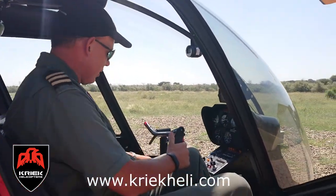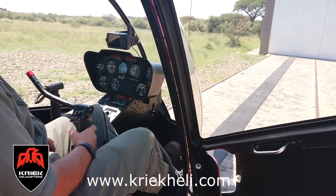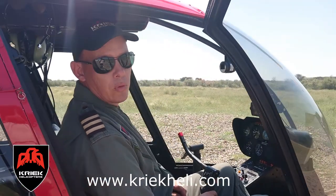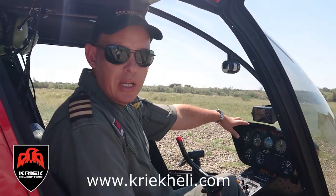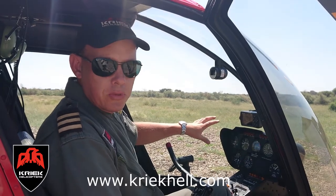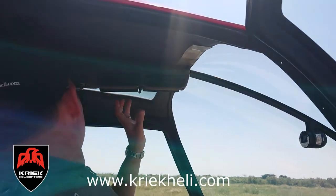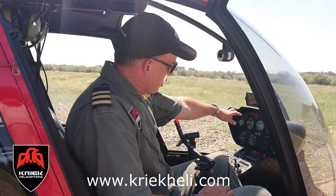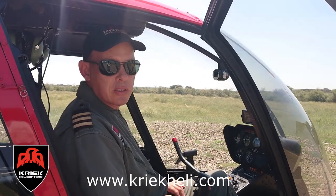This is your pilot seat. Your cyclic lever controls your direction, and there are your anti-torque pedals left and right — basically to counter the torque reaction of the main rotor. That changes the pitch on your tail rotor for torque either to the left or right. You've got your avionics switches — this is the older Robinson cockpit, but you can now get a new one moving more towards the glass cockpit. You can see this machine also has air conditioning up here — it's got a very powerful unit. Leather seats, four seats — pilot plus three passengers. It's got night instruments, artificial horizon, DIs, GPSs, everything. It's a very nice machine, very fast, powerful and efficient.